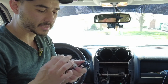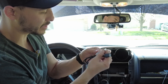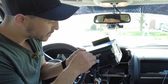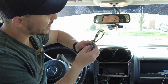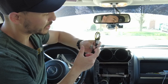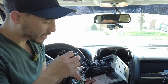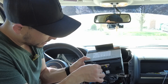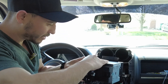Here we have the USB cables. This one is called the Phone Link USB — the single 4-pin USB — and it goes into its specific slot since each slot is its own size. Then we have a 6-pin USB cable, which is probably for CarPlay or charging. I'm going to go ahead and plug it in because you never know if you're going to use it, and it's better to have it available so you don't have to take everything apart again later.